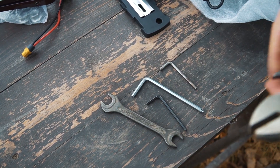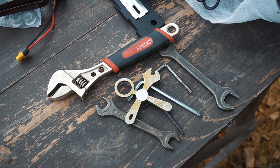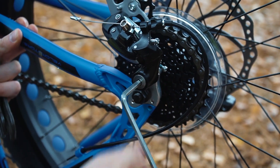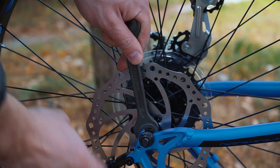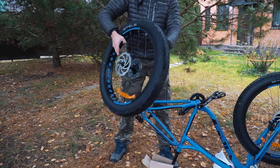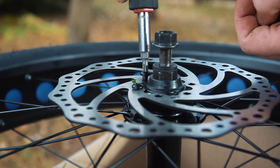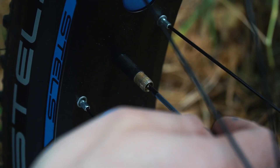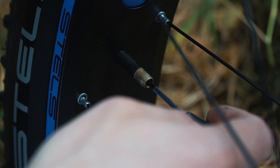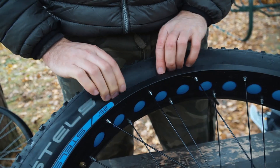We will need these tools — some kind of wrenches, and the most important, this one. First of all we need to take off the rear wheel. To do that we should unscrew the gear and take off the chain. Then let's unscrew the disc brake. After that we need to take the tire off the wheel, so we lower the pressure to the minimum. We have a soft rubber here, so I do this procedure just with my own hands without tools.